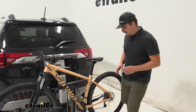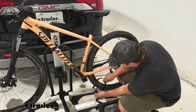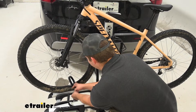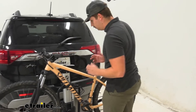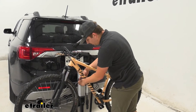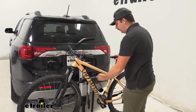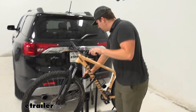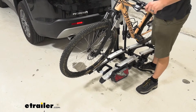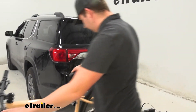To get our bike unloaded we'll start by undoing the wheel straps at the bottom, pulling up on this button here and undoing the ratcheting strap. We want to do these first because the clamp up top is what's actually holding the bike upright. You will notice that the bike rack is going to continue beeping — this is a safety feature to make sure we don't accidentally start driving away with the rack in the lowered position. So until it's raised back into its natural driving position it'll continue to make that noise. With everything undone, I can just easily roll the bike down, watching out for the pedals around the mast, and then walk it off to the side.